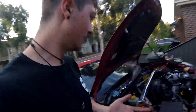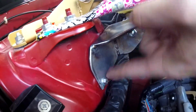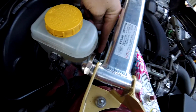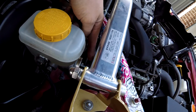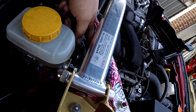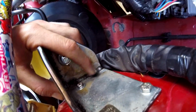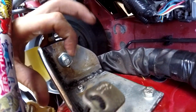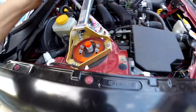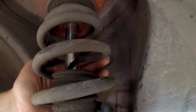It is all in, we're done. Up in a bit of paint, so it's solid. One-two mount, a little foot stopper, adjustable. So I just had a 13mm spanner there, and then an 18mm spanner on that nut to tighten up between the brake booster and my brace. And then on the back side with these ugly welds, because I didn't grind the gal back, I just got another nut, so then that just locks all that in. And then on this side, you got the two rev nuts in there.